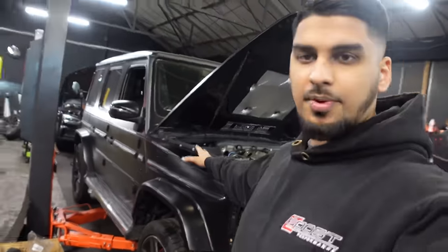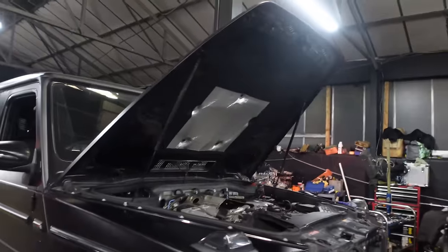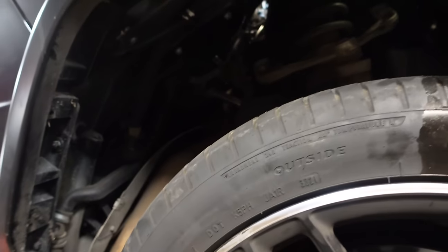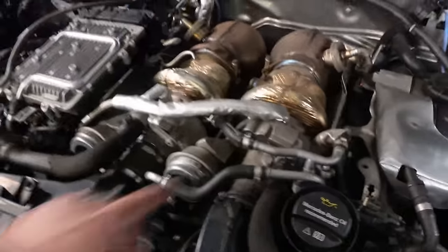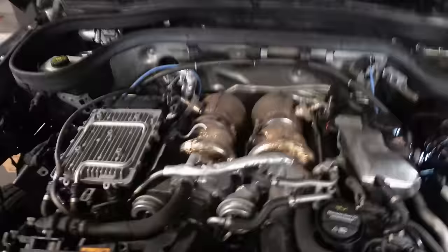We've got a slight change of plan — we're not going to take the body up anymore. We're going to do it a different way because it just doesn't seem worth the hassle. There's just too many fuel lines and things below to strip down. Instead, we're going to cut the pipe from there, which will allow us to put the pipe upwards and remove it. Those are the two turbochargers right in the center of the engine — that's the reason why we couldn't just pull it out. The pipe goes that way, then crosses that way, then that way. And there's an OPF filter down there which is why it wouldn't come upwards or downwards. So we're just going to cut in the middle and make life easier.